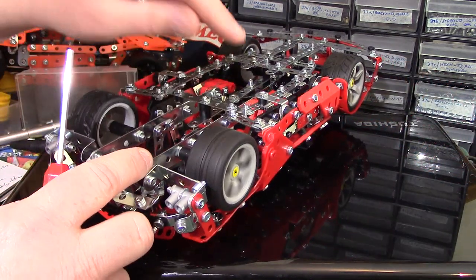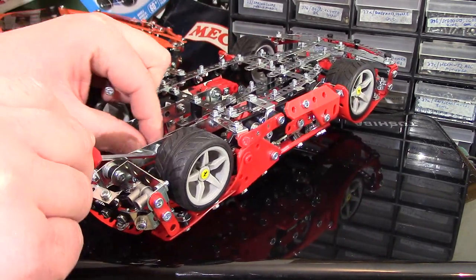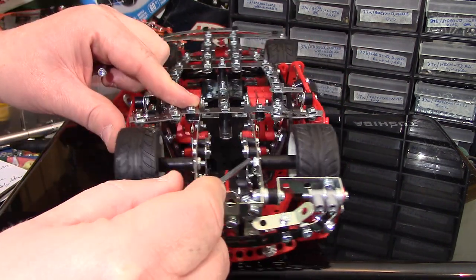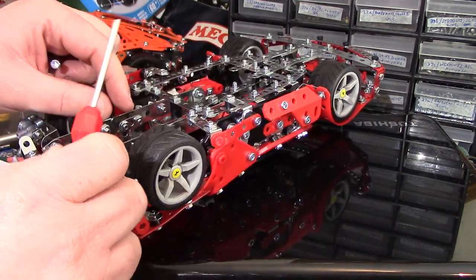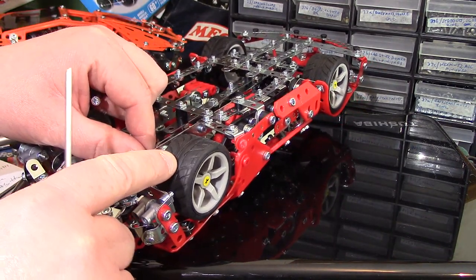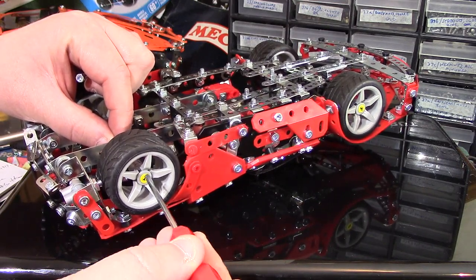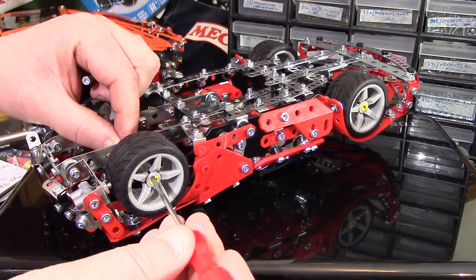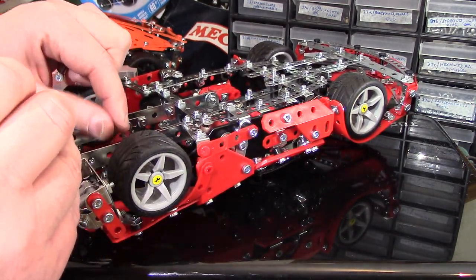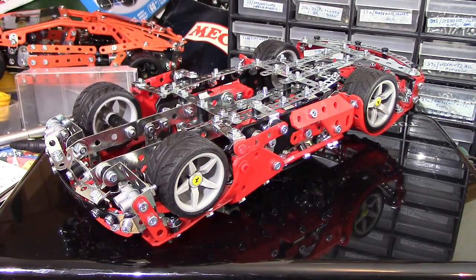Once you've got your amount of play right in the wheel, you've got to lock it up — either side there's a nut, and it's a case of tightening those against each other without altering the play. At this point, tweak gently, tighten up — too tight, undo, slacken off a fraction, tighten up again. It takes a little bit of time but nowhere near as long as the Aventador.